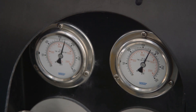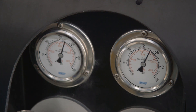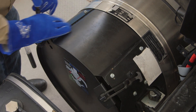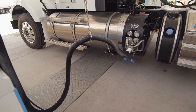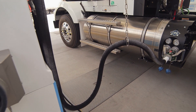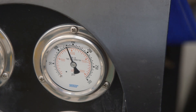If pressure is above 150 psi, you should remove some vapor from the tank before adding fuel. To remove pressure, open the tank cover and turn the green vent to station valve counterclockwise to open it. Natural gas vapor will begin venting back to the station through the fueling hose. Close the vent valve when the pressure gets down to about 130 psi.